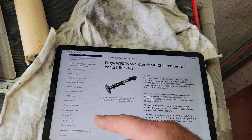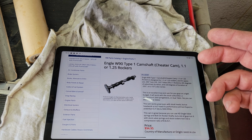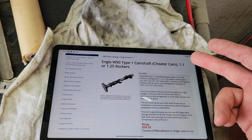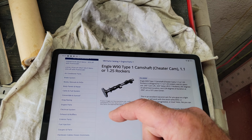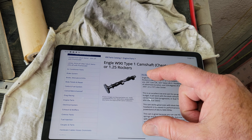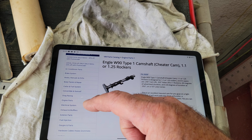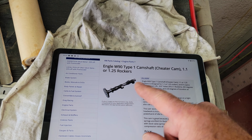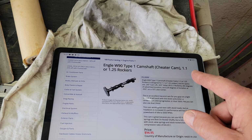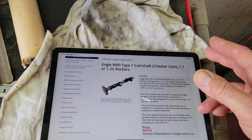And so if you put your cam specs to where they're too large, you end up having to have 6,000, 7,000 RPMs for the cam to actually start to work. And the problem with that is, to get to those RPMs, you're going to have to go with forged pistons. You're going to have to go with H-beam rods. You're going to have 100 pounds of oil pressure, 70, 80 pounds, 90 pounds of oil pressure. You're going to have all the stuff and probably a $2,000 crankshaft, stuff that's going to get you to that range. So a lot of guys will screw up and they'll get too big of a cam, and you end up just building something that doesn't work right.